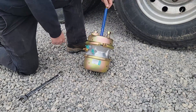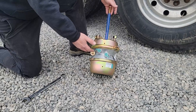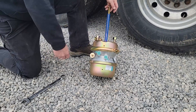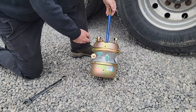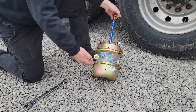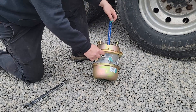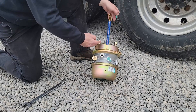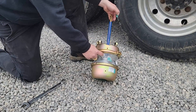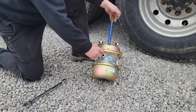This is a pretty typical 30-30 brake chamber. There are a couple different versions, and they're easy to tell apart if you pay attention. They make a standard stroke and a long stroke. The standard stroke are typically like this one, where the air fitting screws in and it is round. If it's a long stroke, this part would be square — you still have round threads in the center, but the actual casting would be squared off.